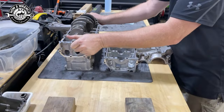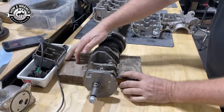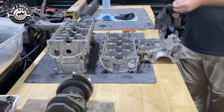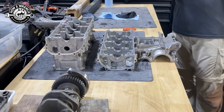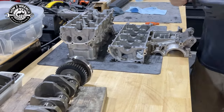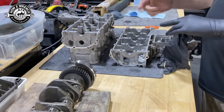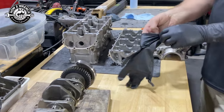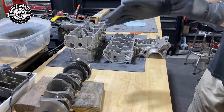Now what I'm going to do is I'm going to simply just take my crankshaft — it's not super important here at this point, I'm just setting this up so it's not going to roll around on me. Next thing you want to do is put some gloves on, because per every plastigauge bearing manufacturer — I don't know why — but they tell you don't touch it with your finger. The little bit that I've heard is that the oils in your fingers are contaminants, especially if you pick anything up off the bench, and can get into that bearing. So one thing we want to do is treat these with really, really, really, really good caution.